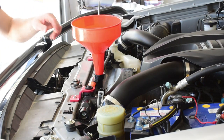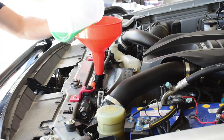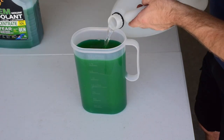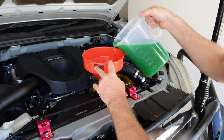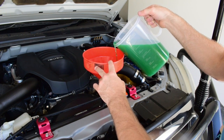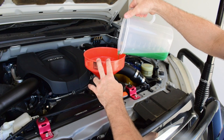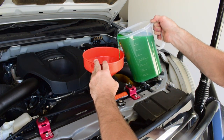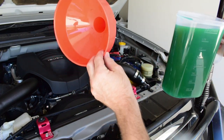I'll put the funnel into the top of the radiator and pour the rest of that coolant in slowly. Now I'm just going to go make up another batch of coolant and keep topping up the radiator. By measuring all the coolant we drained out of the system, we know exactly how much we need to put back in. By pouring the coolant in slowly we ensure we don't get any air pockets or air bubbles caught in the system — filling slowly allows that air to escape through the radiator before the coolant goes in. On my last bottle of coolant, it starts to overflow the radiator, so I'll put this aside and let it drain down a bit.